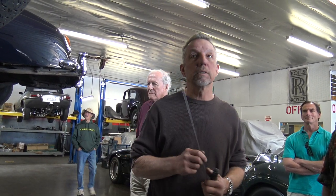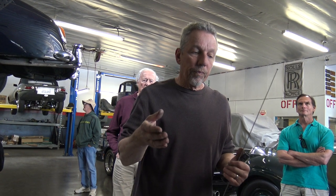So it's always good to exercise things. I always encourage people to drive their cars on a regular basis — and I don't mean start it up in the garage, let it run 15 minutes and then park it. I mean take it out on the road, exercise it, roll the windows down and up, turn the AC on, turn the heater on, make sure the valve opens and circulates, and operate the parking brake on a regular basis. The seats are another good thing — all these electrical components, especially window motors and seats, have gear boxes and motors with grease in them. If they're original on a car that's 40 years old, the grease sometimes petrifies, and sometimes the brushes get corrosion on them so they don't want to work when you need them. It's just like our own bodies — we have to keep moving if we want things to work.